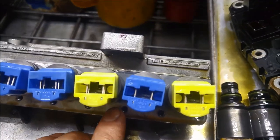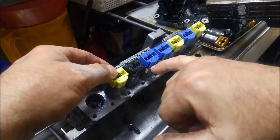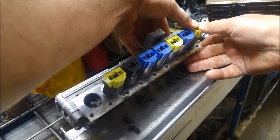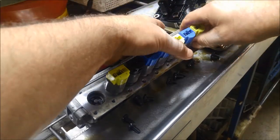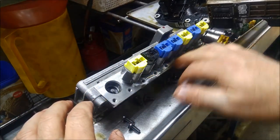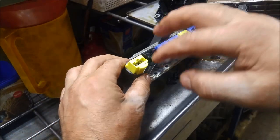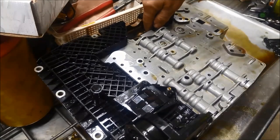What I like to do before tightening the solenoids up with the little bracket is put the mechatronic unit back on just to make sure they're meshed in properly, then tighten everything up. When putting solenoids in, don't just force them — that can damage or cut the seal. Put pressure on it and wiggle it around and it should just pop in. Sometimes you might need to rotate it a little bit. Once all are in, put the mechatronic unit back on with the plate just loose first, so you can get the contacts as good as possible on those terminals. Don't forget to line up the little selector shaft.